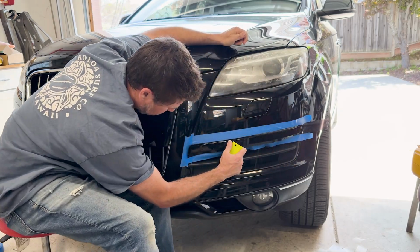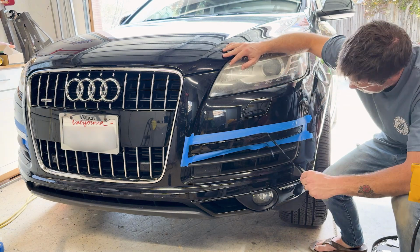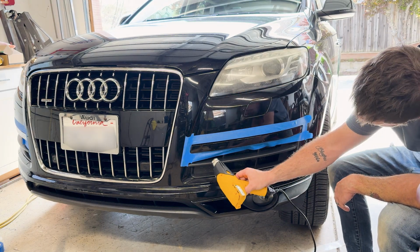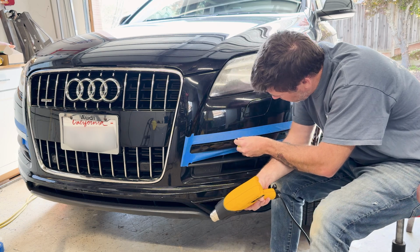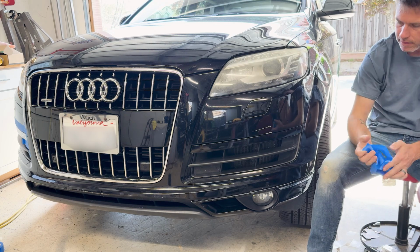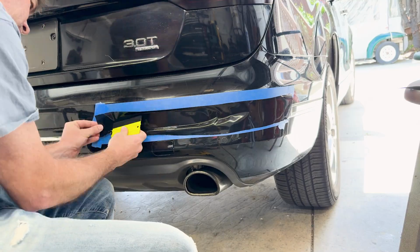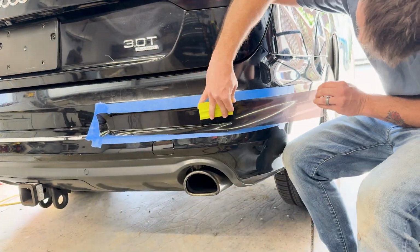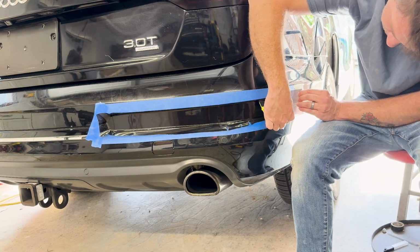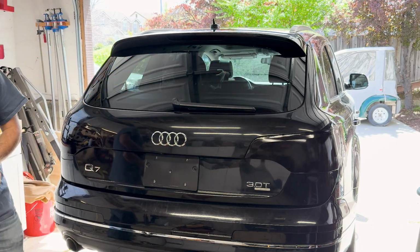All these blinker and running lights across this car are just giant flat curves, so super easy to work with and wrap. All I did was cut the vinyl into 2-inch strips and laid them across the masked off light area. Then a little dust coat with the heat gun and just barely on these flat lights, because the vinyl doesn't need to be as soft as when pulling around a spherical kind of shape. Now I grab my new favorite tool after it's been warmed up, the hard edge squeegee, and make sure that the vinyl is sitting across the whole light flat. Then all you gotta do is warm it up to get it around the light, cut away the excess, heat it and curl it to lock it into place, and pull away that tape. You all know the drill.